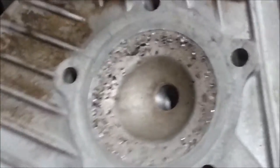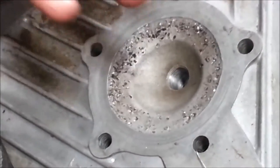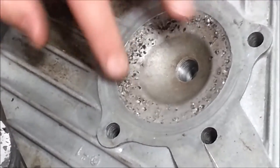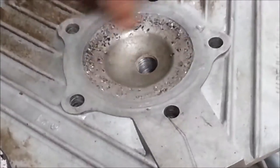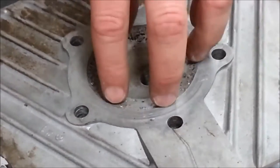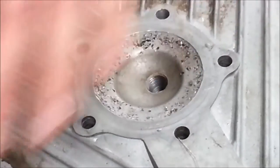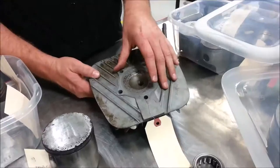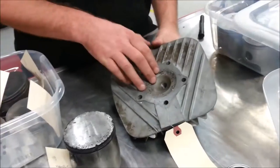A lot of guys think they're just going to get their little Dremel out and sand those down and be okay. What's the problem with getting your Dremel out? We're not going to have as much compression — as I dig this out, that means there's going to be a larger cavity here, which means I'm not going to be able to compress it as tight. So we will have a loss of compression. It'll run, it's just not going to run as good — we've taken compression away. Why not just put a new head on?